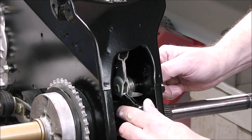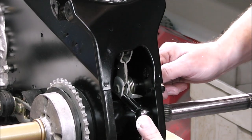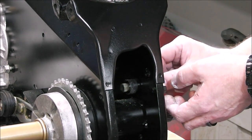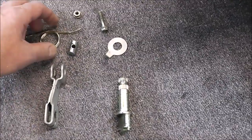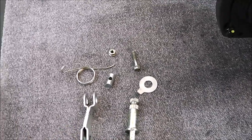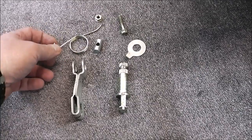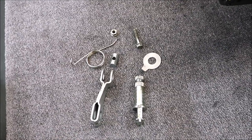I'm just going to take apart this back brake adjuster and clean it up and lubricate it. We'll get this working nice and smooth. Now we got all our parts cleaned and we just got to put it back together. I don't do anything fancy to clean the parts — I just use a degreaser. If they're really bad, I spray it down with kerosene in a squirt bottle and use a nylon bristle brush, then wash everything down afterwards with a degreaser. That's it.